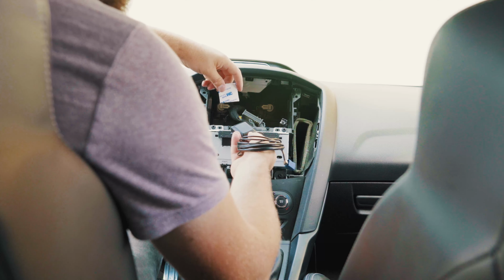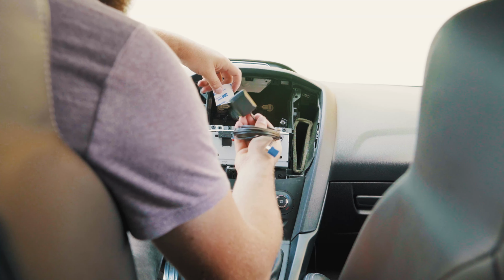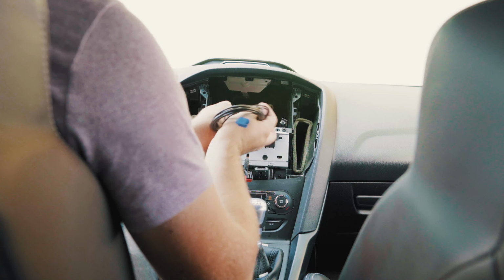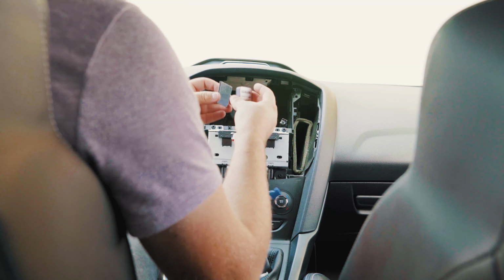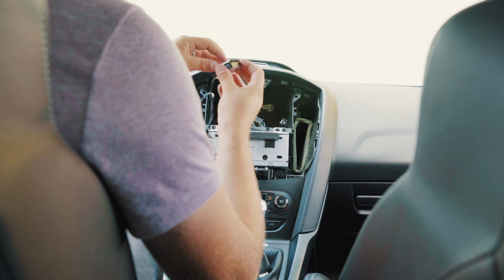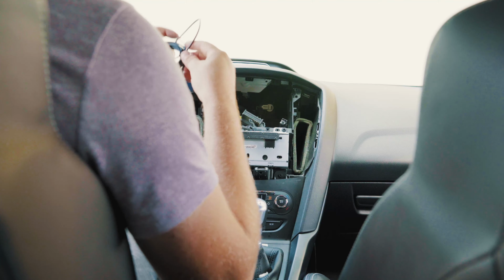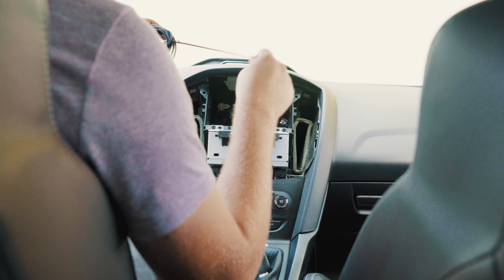No matter if you're upgrading your car to non-nav or navigation, you're going to need a GPS antenna just like this, as it helps with emergency calling and syncing clock time. So let's get this installed. We're going to take our 3M sticky pad, provided in the NaviUpgrade kit, and place it on the top of the antenna just like that. Then we're going to peel the other side. Once we do that, we can get a couple strands out. We don't need much, just a little bit.